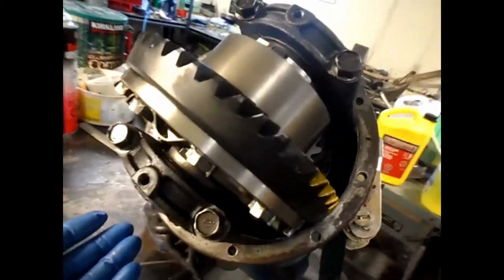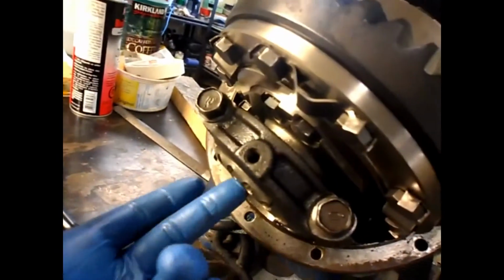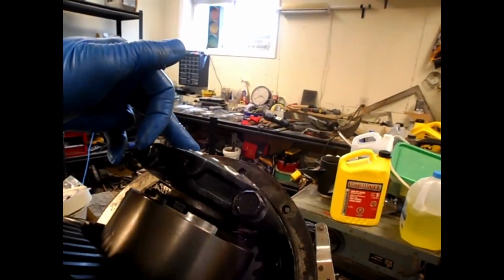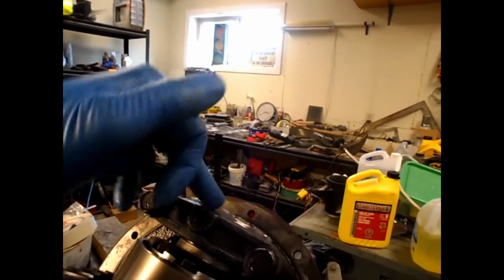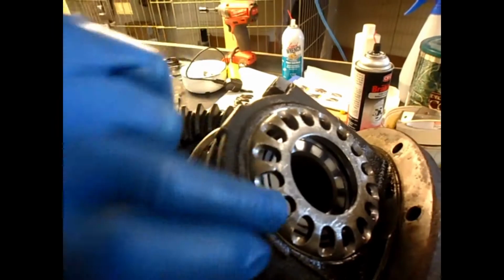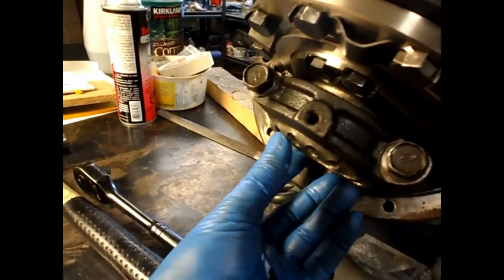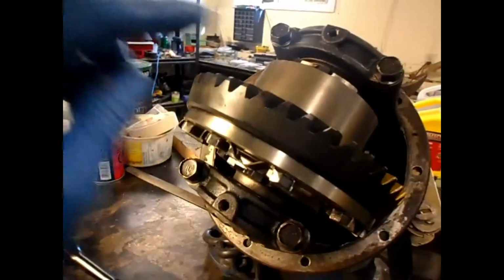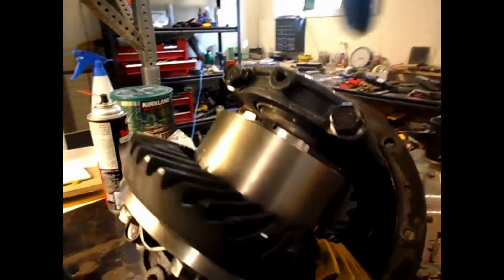Okay, so I did my steps. I tightened the ring gear side down to 0.2 millimeters. I then sucked up all the backlash on the pinion side. Then tighten the pinion side 1 to 1.5 of these holes, in a tightening direction, to put some preload on. Check my backlash. Adjusted this to get between 6 and 8 thou on 4 different spots on the ring gear. Every 10 teeth I checked the backlash.